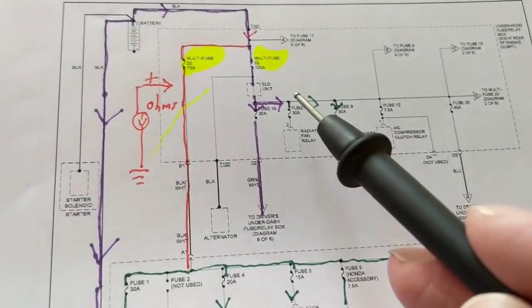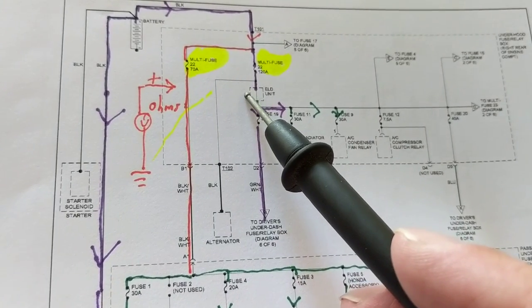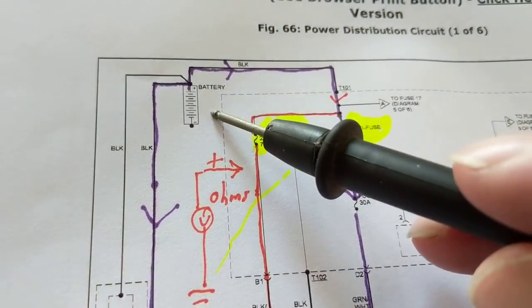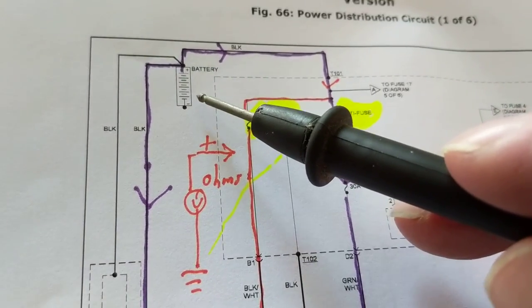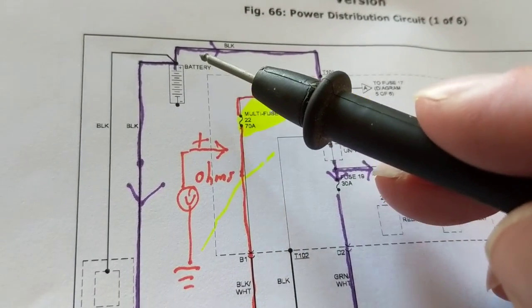Remember, if you have a bad alternator, your battery will die because it didn't charge it up. It takes about maybe 20, 30 minutes to charge it up fully. So that's that. Now, the other thing is a battery test. A battery, your lead acid, has an internal resistance in it. Think of it as a resistor inside. The more the resistance, the more it was discharged.